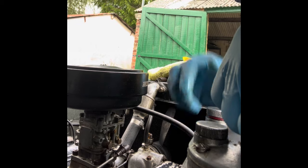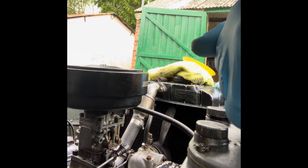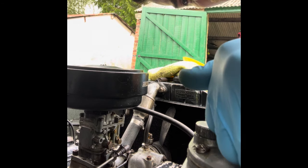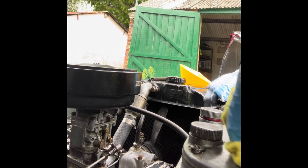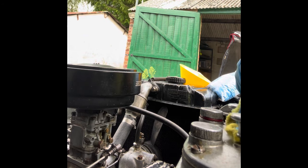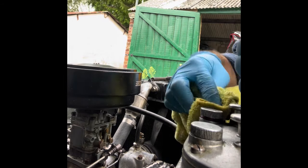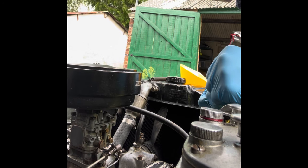There's a heck of a — let me put this up. This is full pressure in the brake system, pumped up. Let's make sure none of this excess fluid comes up. It's probably a good idea to replace the brake fluid in this car every year or so, because you don't want a completely sealed system and you don't want it to absorb too much water.